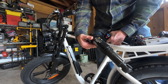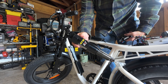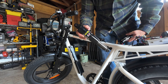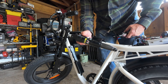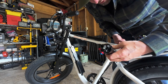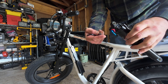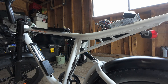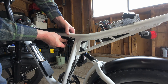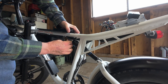The rear shock has been removed. This is a 230 millimeter shock on this version, but I did see another video where the guy replaced it on his M20 and it was a shorter shock, so measure before you replace the shock on your M20 - there have been a few revisions. 230 millimeters is right around nine inches. Put this with the valve facing down so you can still access the air pressure. Get it lined up - pretty simple. We have the shock in place now, just going to bolt it back in and set it to our weight settings. You really only need a ratcheting wrench to swap out the rear shock.